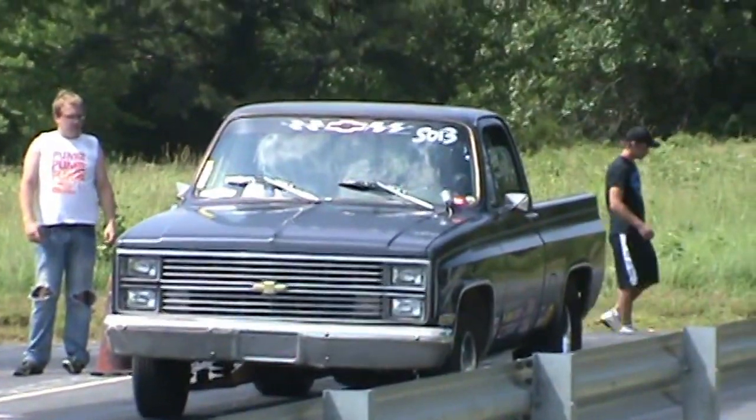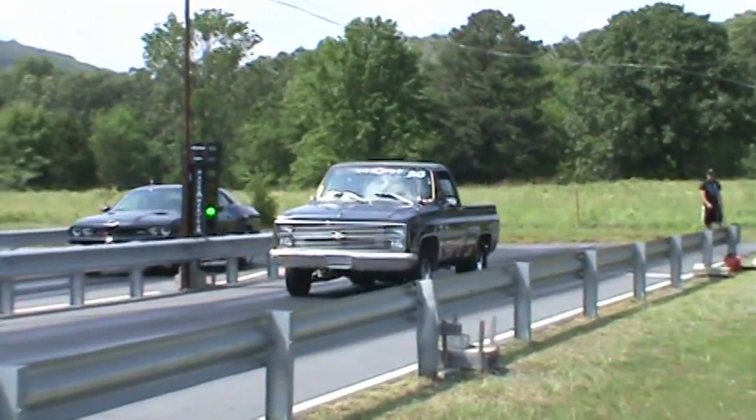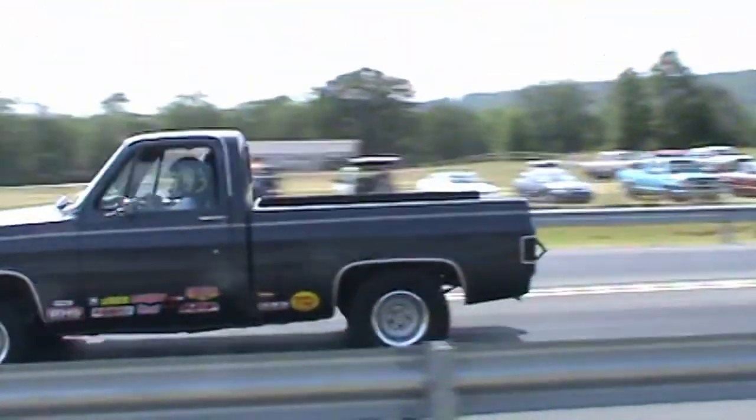When you're going around a curve or making a sharp turn, you need one wheel to slip a little bit, because otherwise the other one is going to have to slide. That can make your tires wear out sooner and it can make you lose traction in turns, which could make you slide — and that could be dangerous. So now you can see why a limited slip or a locking differential would be beneficial over a spool, because it kind of gives you the best of both worlds.